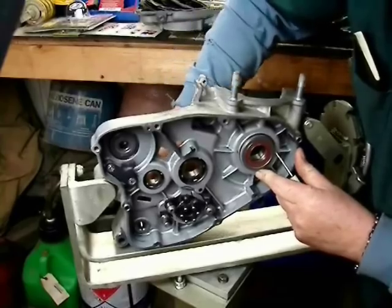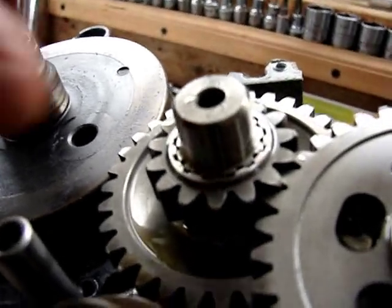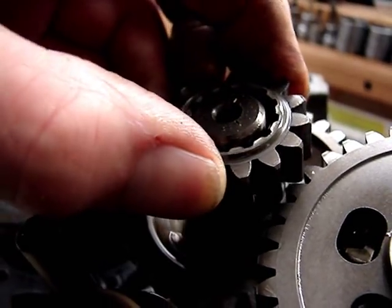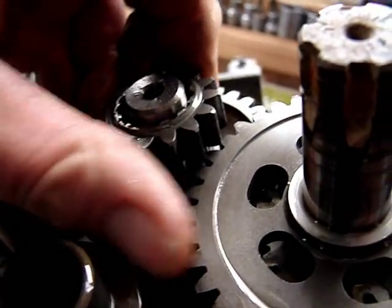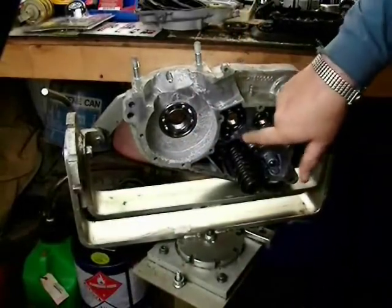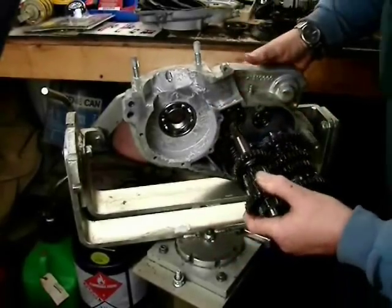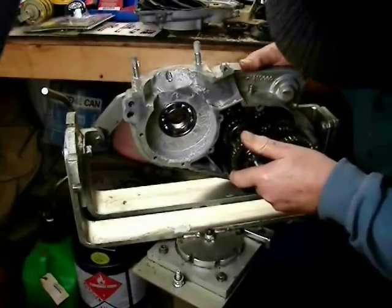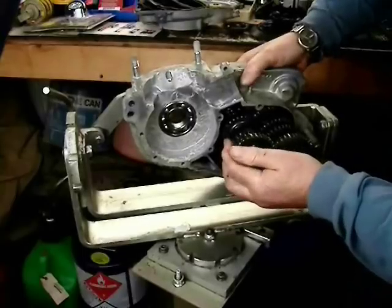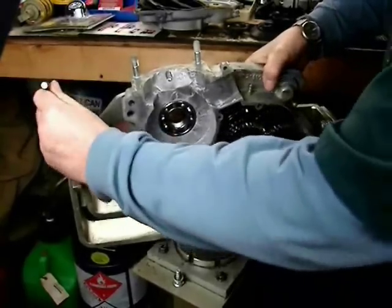After a quick test shift returning to neutral, I like to install the gearbox upright. There's a gear on the primary shaft — the clutch shaft — it has a shoulder on it and the other side is flat; the shoulder faces out. I use automatic transmission fluid painted on my parts to make things slide. The transmission assembly just slides right in there with a little wiggling — that's not an interference fit on those bearings. I put it in sideways so that little shim washer doesn't fall off.